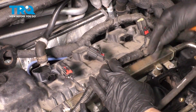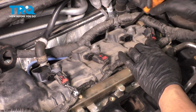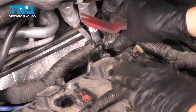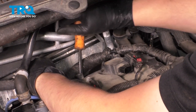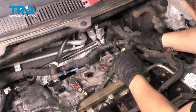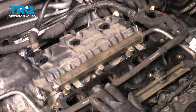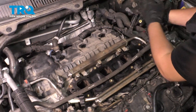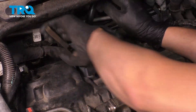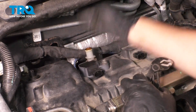With the ignition coil connectors off, you don't have to unplug the fuel injectors — you can if you want to, but you can just get this off of here and set the whole harness aside. There's one more retainer over here — this is the kind that slides over the stud. The harness is loose now, so put it over this bracket to get it out of the way. You can also unplug the fuel injectors to set the whole harness further aside and have a clear shot at the valve cover. Twist this hose a little to get to the clamp better, grab it with pliers, slide it up and off, then pull the hose off and set it aside.